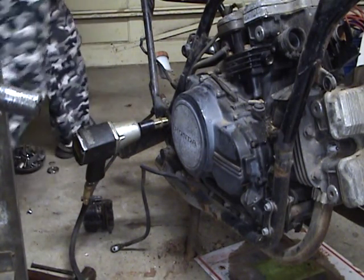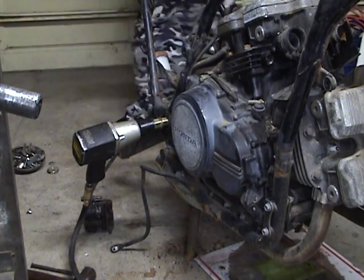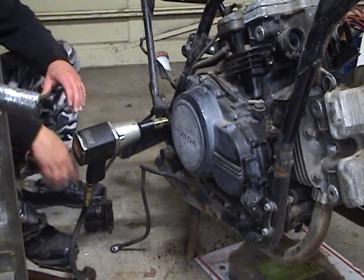Turn the air pressure up a little bit here, and grab a breaker bar. That's, I think, around 700 foot-pounds on that Craftsman half-inch. It's got pretty good breakout, but we got a 2-foot or so Snap-on breaker bar. I can actually get more breakout with that breaker bar than that impact.